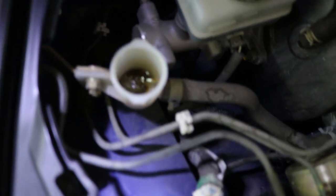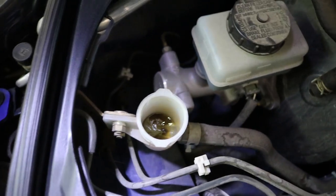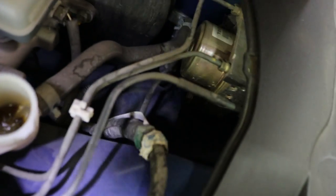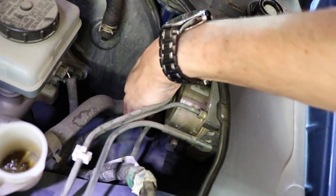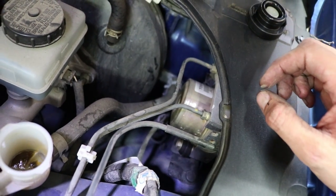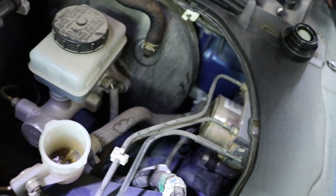You can see up here and take a look inside my reservoir - it looks really bad. What I'm going to do is unbolt these two 10mm right here for the reservoir. Then I'm going to move back here, and underneath the ABS pump there's the hard line where it connects to the master cylinder. I'm going to take that 10mm off there, and then move inside and begin taking off everything else.